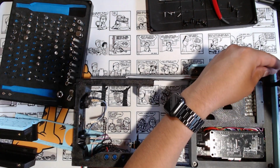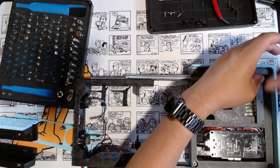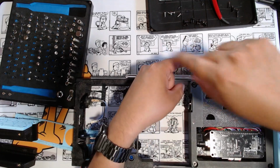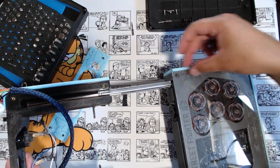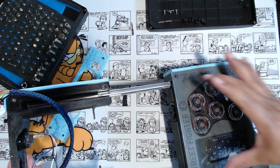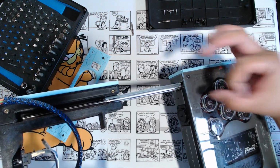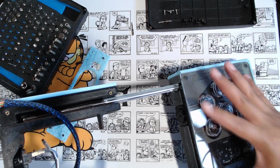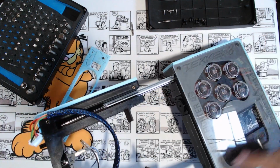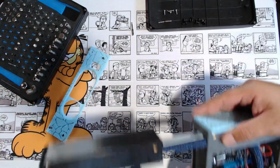Over here on this side though, I had the thicker screws that went in there, and that was because the rails are attached to this piece on the outside and not the inside piece. So I need that bigger piece to be structurally supported, so I used the thicker end screws on there. But again, the acrylic piece out here is going to support the overall frame too.